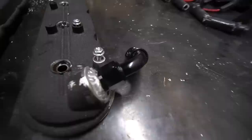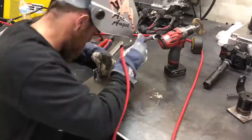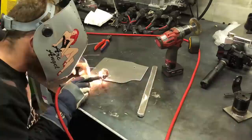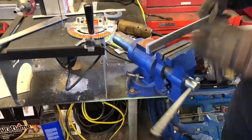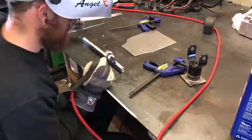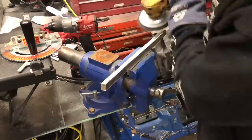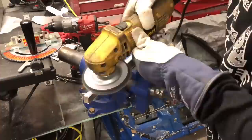To clear my head, more TIG welding. I welded AN bungs onto my valve covers so we could get our catch can set up with nice AN line. Then I got to work on the handbrake assembly. From version one, we didn't have a handbrake because I wanted to build this remote mount unit. There's not a lot of room in a Miata on the trans tunnel, and our shifter had moved back creating an even larger hole to cover. The plan was to build a plate, build a handle, and remote-mount the reservoir out of the way to keep things clean. I cut four aluminum strips, welded them together, but the weld didn't come out as nice as I hoped, so we ground it down and drilled some speed holes to try to make it look better.